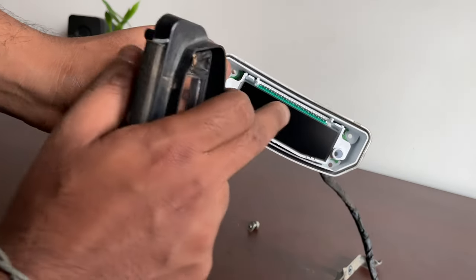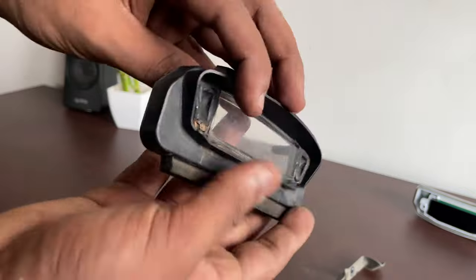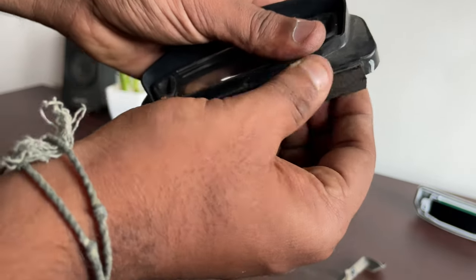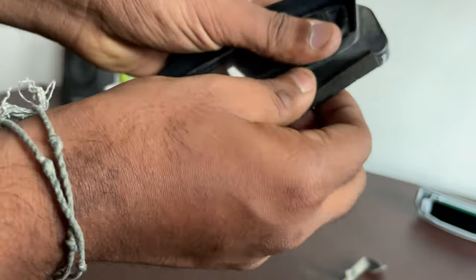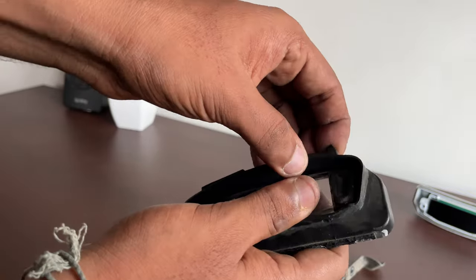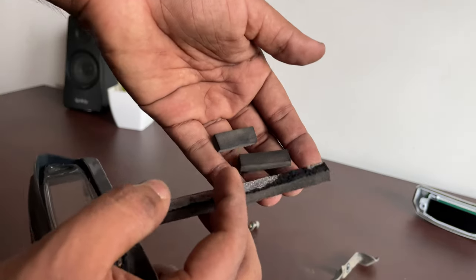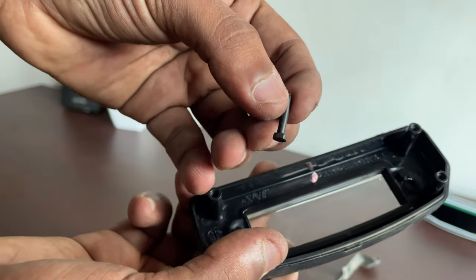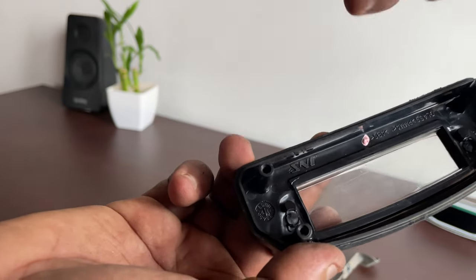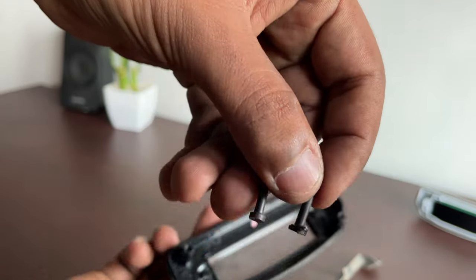Keep the actual display safe — you don't want to damage it, so let's set it aside. Now we have our old used top cover. Take these foams — you don't get this foam with your new top cover so you'll need to reuse them. You'll have three pieces of foam and two small plastic pieces. These are the pieces which press the actual button in the display, so they go to the back of the actual button. You need to take these two pieces out.